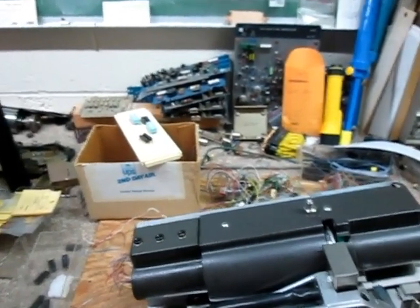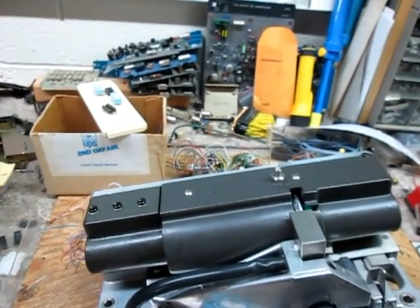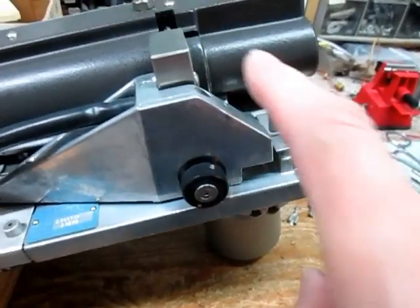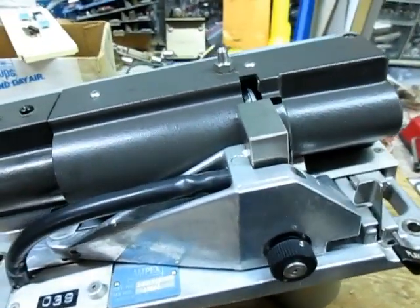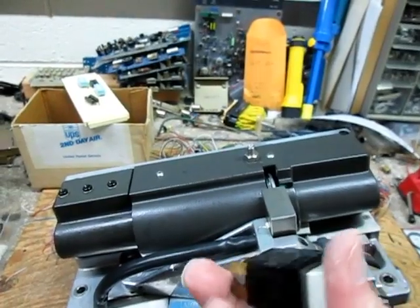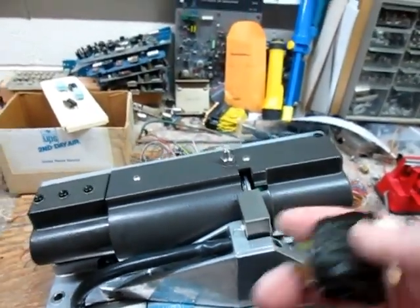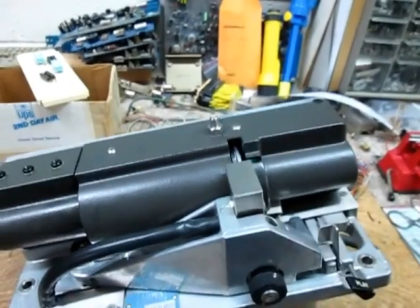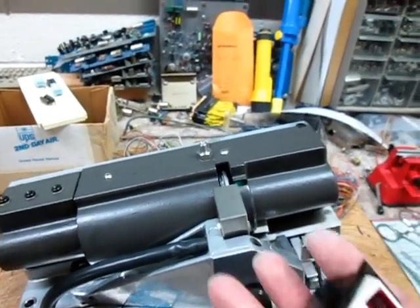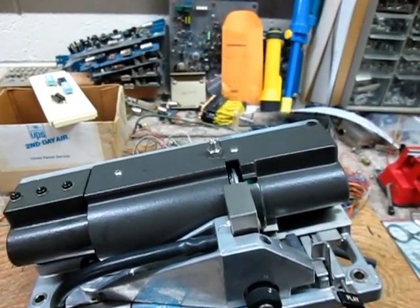What I'm going to do is take this little cover plate off of the connector here. This is where two of the wires from the guide solenoid that engages this guide when in play are located. I'm going to break that circuit and bring it out to a switch, so I can manually turn this solenoid off and disengage this guide while the tape is in motion in playback mode. Once the bad part clears the guide, I can re-engage the guide and go on playing.